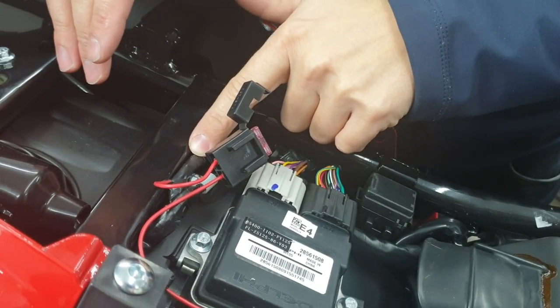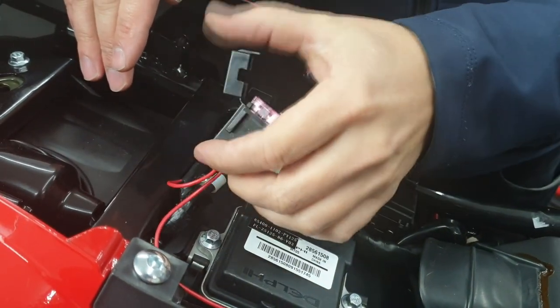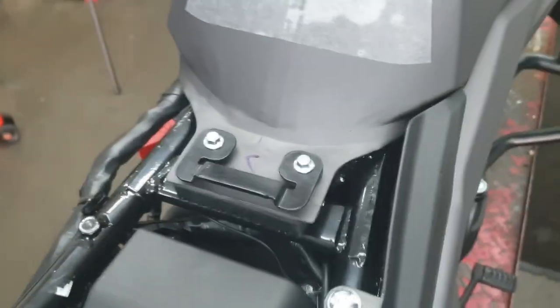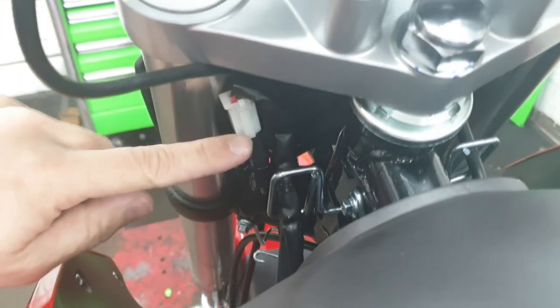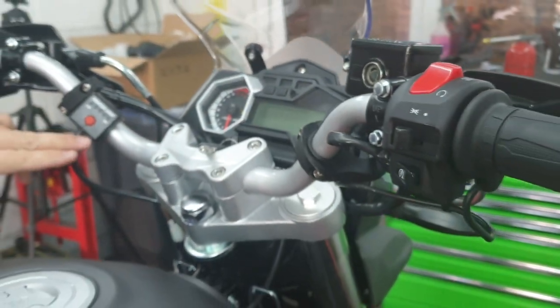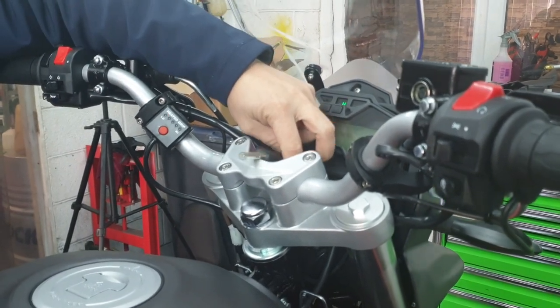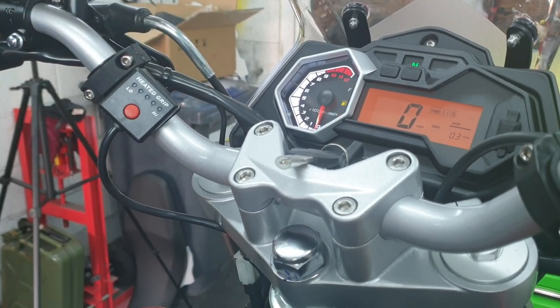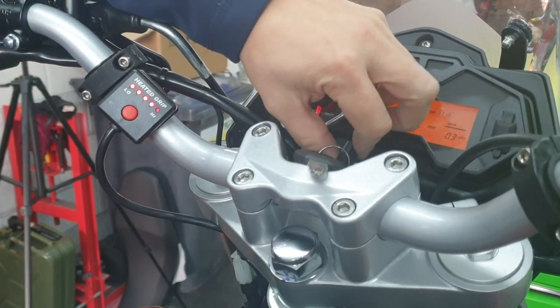Finally got all the accessories fitted to the Terrain. We hardwire the heated grips into this bike on a switch live — solder connection with heat shrink to a switch live on the accessory connector, through a 4 amp fuse. We route the wiring down the side of the bike; the earth strap splits off and comes through onto the battery. The rest of the wiring runs underneath the tank, comes up in front of the bike through the cable tidy, and we tie-wrap the connector wires for the heated grip left and right with the control block mounted to the bars. When you turn the ignition on the heated grips come on and you can set different levels or turn them off — you never leave them on because it's wired with the ignition, so turn the ignition off and the grips go off as well.